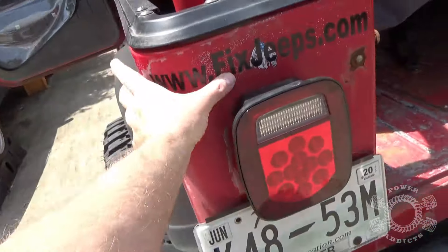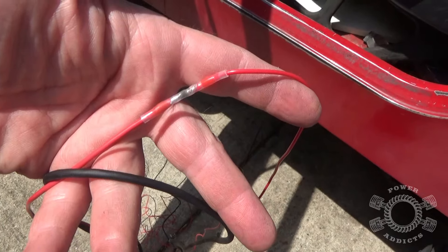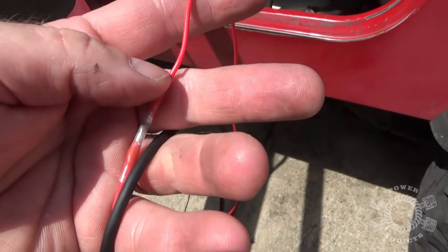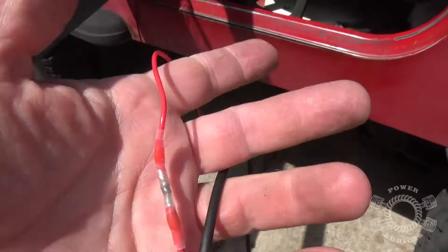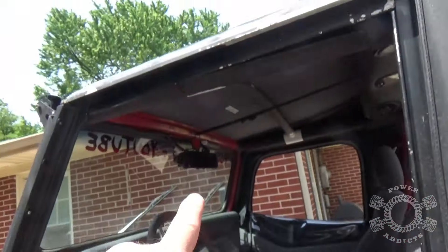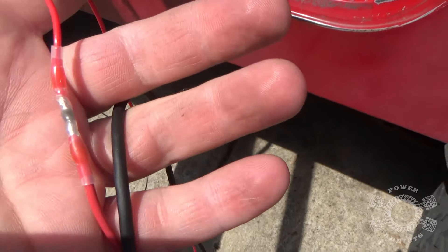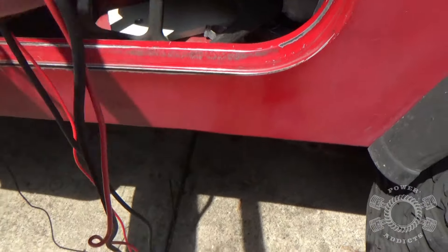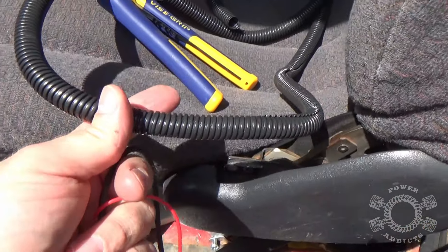Here's the wire that activates the camera. Typically this red wire hooks up to your backup light, so whenever you throw your rig in reverse and get ready to back up, it activates — turns on your backup lights back there, which energizes this wire and tells your camera to switch to rear view. I want it activated by a switch instead, so I soldered a heat-shrink connection and a wire to it. You can see the red wire stringing along through there, but I've got to get all that through this — that's going to be fun. Let me show you guys a little trick.